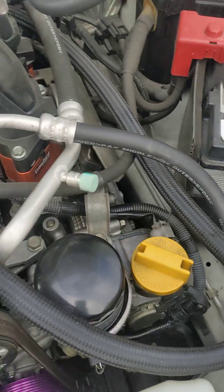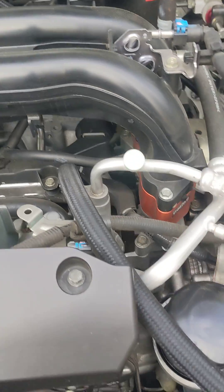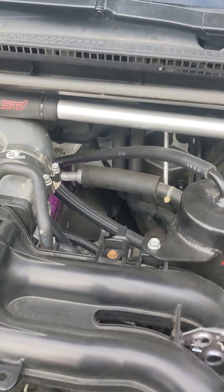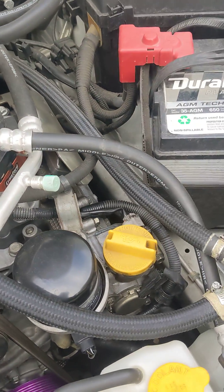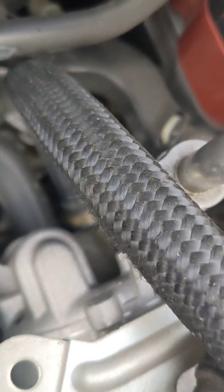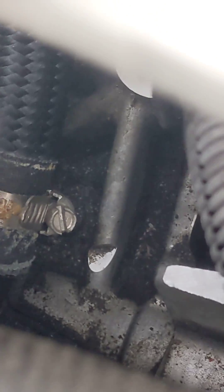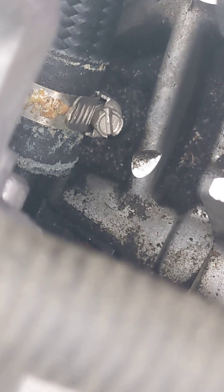It works, but it's far too small. So I think I could do a direct routing from there straight up to there. But I worry about the oil, because you can see how much oil there is down there. My engine — I don't know about you guys — but my engine, when it uses oil, part of its oil consumption is through this PCV or this breather stuff. It's about time to replace those anyway. New solutions coming through.